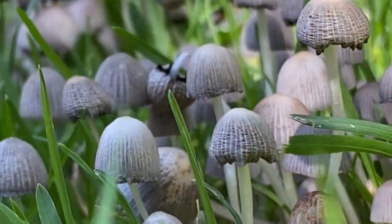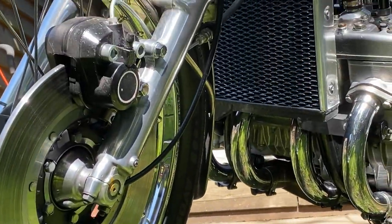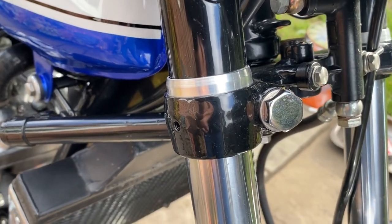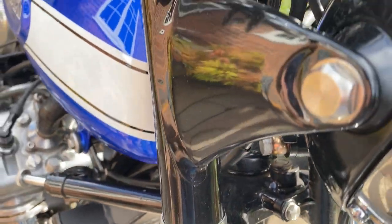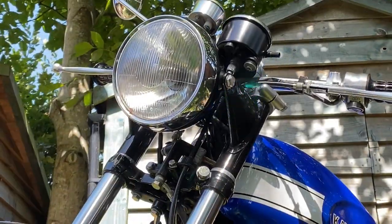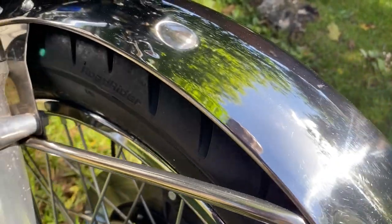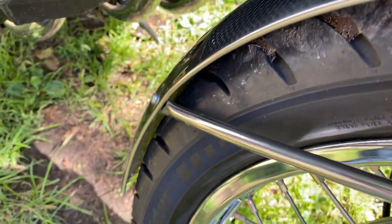I'll walk around the bike now explaining some of the features. The front forks, front wheel and yokes are from a Kawasaki H2 because they are much stronger than the early 500 forks. I fitted the standard H1 Kawasaki headlight ears by making special adapters. The headlight is also from the early 1970 H1. I removed the caliper mounting lug from the right hand fork leg to make it more slender looking for the 500 LC. I also fitted a stainless steel mudguard because the H2 mudguard looked too heavy on the bike.